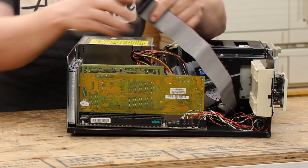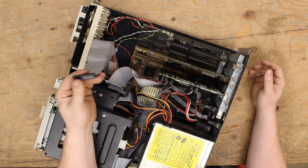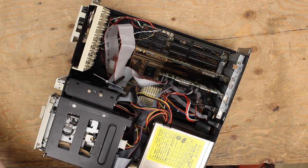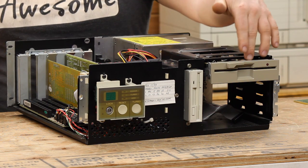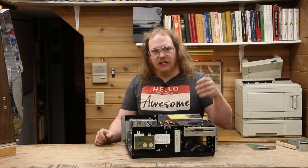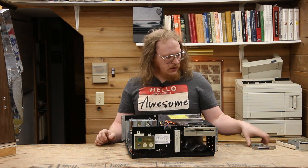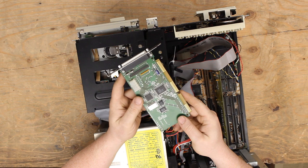When we open it up, you're already going to see I have a 34-pin ribbon cable already routed through the machine — that's just to save us a bit of time with cable routing. On this machine I have a five-and-a-quarter inch floppy drive and a three-and-a-half, so we can't use the typical floppy controller to run the tape drive. We are therefore required to use the FC-20.